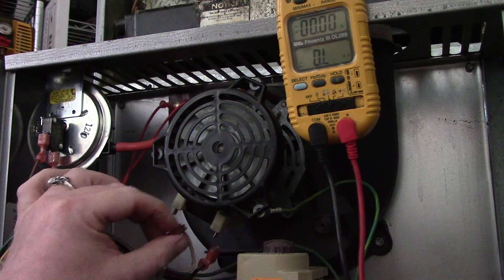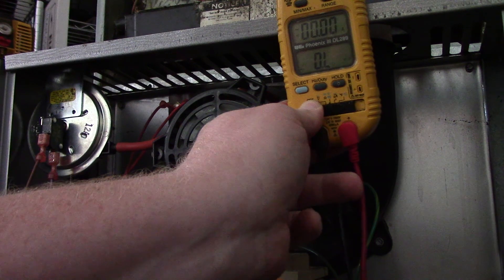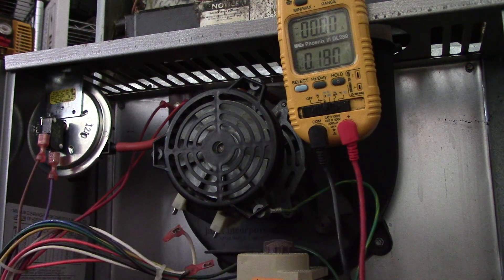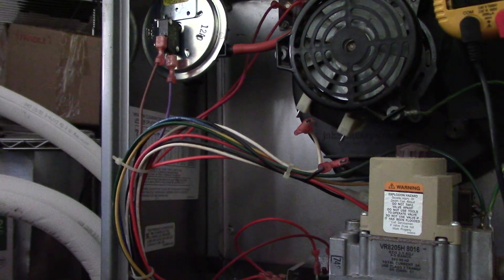What you can check here is if you've got power coming in. This is a 110 or 120 volt item. Put your meter to voltage just like this — put a probe here, put a probe here, and see what voltage reading you have. If you have zero volts right here, don't assume that the board is bad, because those wires come through here. You have a plug that goes here, and then the wires go down to the board. You have to check down here at the plug connection right here at the board.